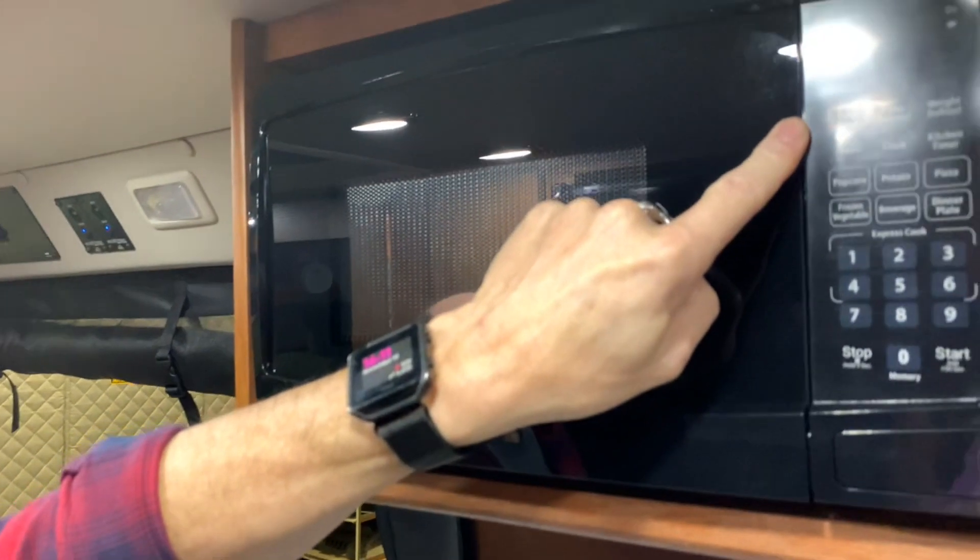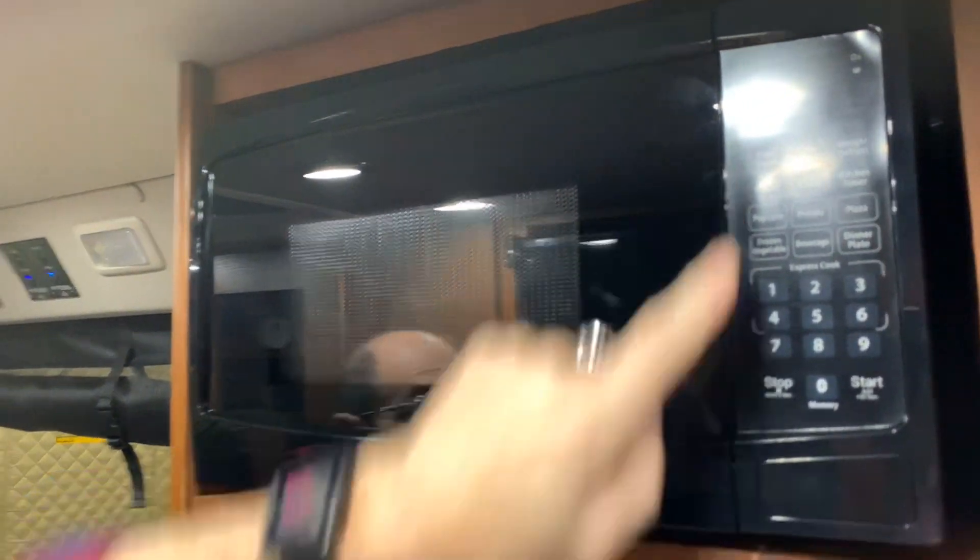One of the quickest ways to identify if the inverter is turned on is to turn off the inverter at the remote switch and look at the microwave. If the lights are still flashing on the microwave, it means that someone has turned on the inverter at the inverter and you should turn it off. Indicators that this has happened will be lower than normal battery life, and as a result your boondocking experience will suffer.